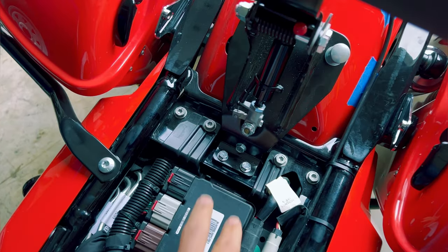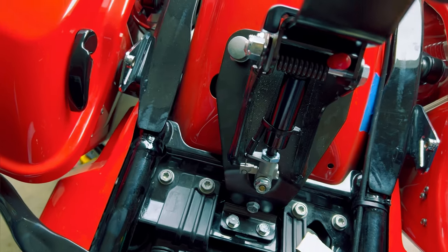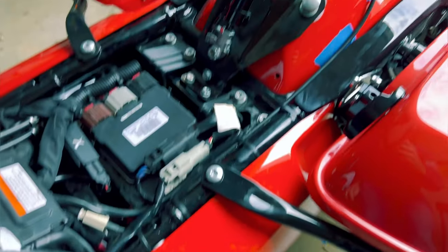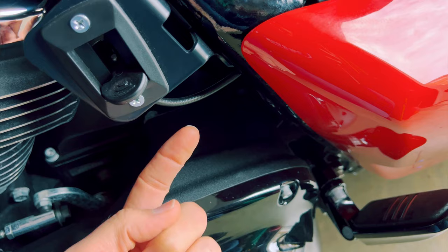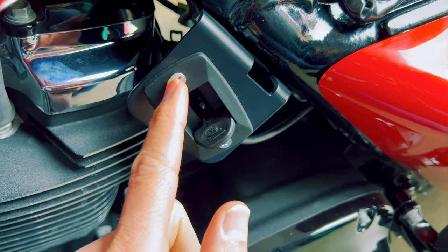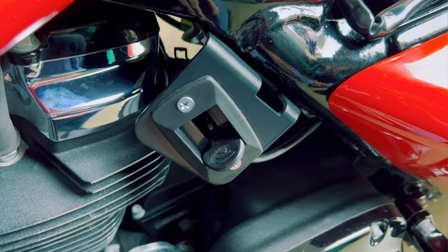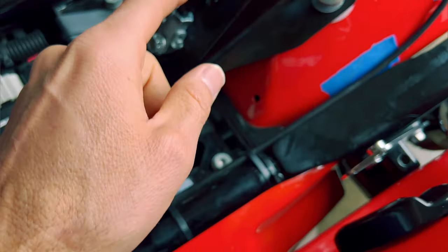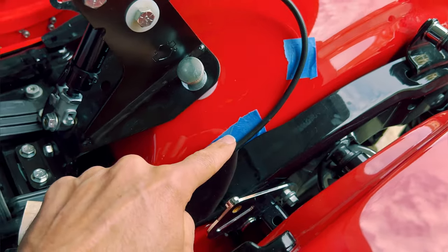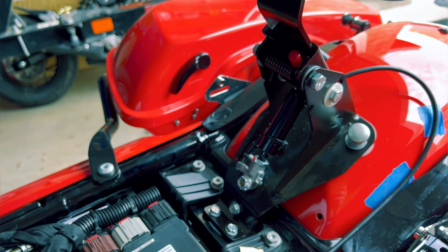Quick overview: you mounted the bottom bracket, mounted this bracket after you elongated the hole, added your bolt, added the nuts on top, and tightened all five down. You took your cable, stubbed it through, pre-assembled the side bracket, put the cable on it, put the bracket onto the frame and attached it. Throw a couple of zip ties on, bring your cable around, clip it in, zip tie it — you're done. If you're like me, add a little protection and a rubber grommet on the top to protect your seat. Now let me show you how it looks on the bike — the backrest is a quick disconnect, you have your little slot in the seat, and you just put it down into the seat and it clips into place.